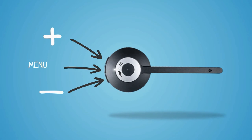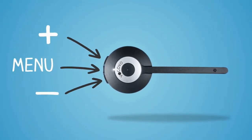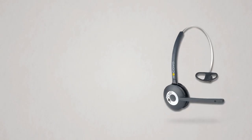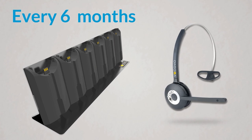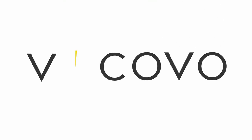Turn off by pressing the volume up, volume down, and the menu button consecutively for 2 seconds. The white LED will blink and then go out. The headset must be recharged every 6 months if not being used, even when switched off. Thank you for watching Training Module 2.